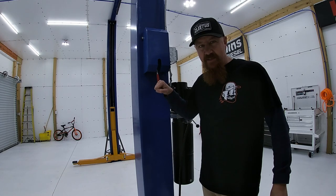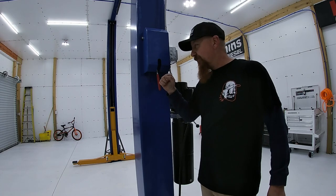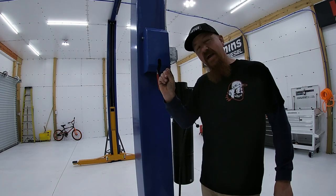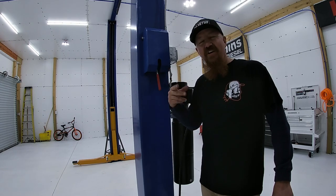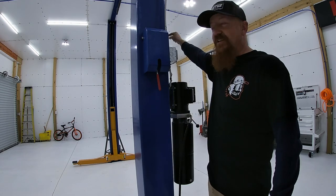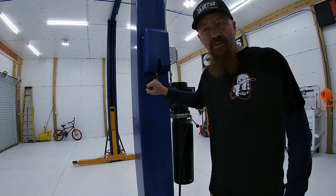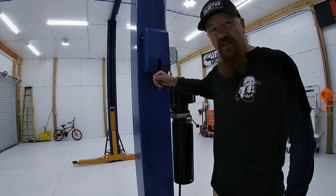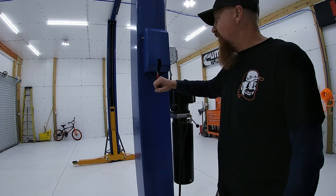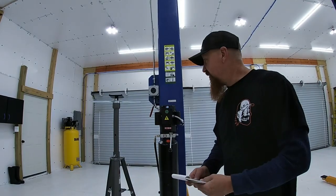Installing the locking mechanisms is very simple and straightforward. The only difficulty was threading the cable through a bolt with a jam nut — the cable frayed out and we had to cut it off and start fresh. The small cable just runs up and over through the pulleys in the top rail and over to the other side. You basically just make sure you pull enough tension on that cable when you tighten down the nuts to disengage both sides as it's coming down.